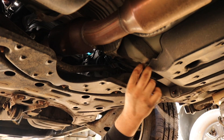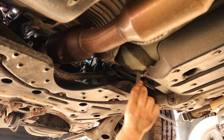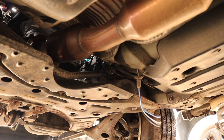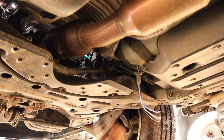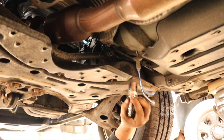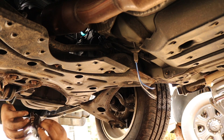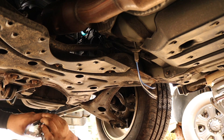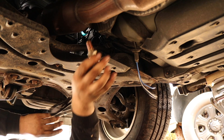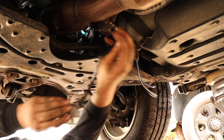And then if you follow this up, you should find a wire connector. This looks like it gets booted into something, but either way, we're going to put in the new O2 sensor. This is what it should look like, but as you can see, it got cut. Just going to take this little tie off of it. Now you can take your O2 sensor here, put it in, and just start threading it in.